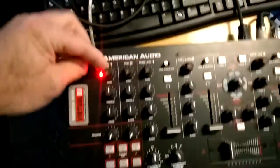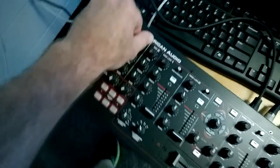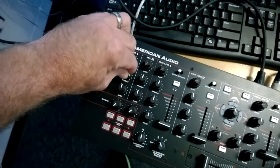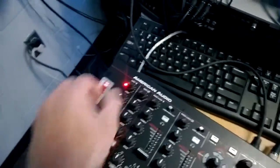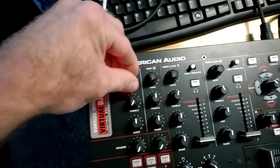If you can't hear that, it sounds like running water in here right now — not an especially large faucet, but it's still there. When I mess with the mic gain, nothing. I've got it turned all the way up and it adds a little bit, but nothing noticeable. Treble — here it goes. Now that is loud. I'm going to go back and turn this down, and I can virtually eliminate all of that by turning the treble all the way down.